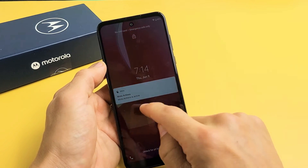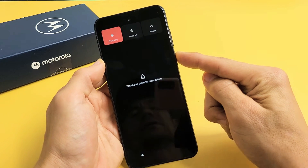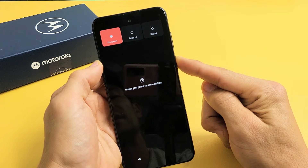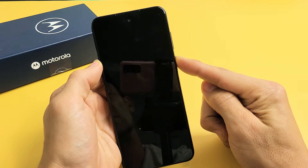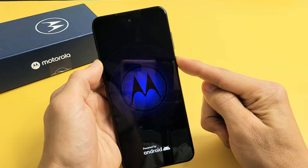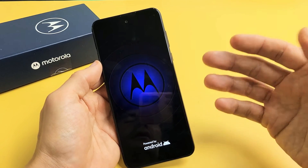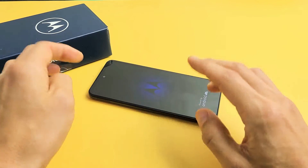So let's pretend I'm stuck in a boot loop here. Press and hold the power button — just hold on to it, be patient. When you see the Motorola logo, let go of the power button. Hopefully it boots up normally and you are now out of the boot loop. If you're still stuck in a boot loop, then we're going to go to the next possible fix.